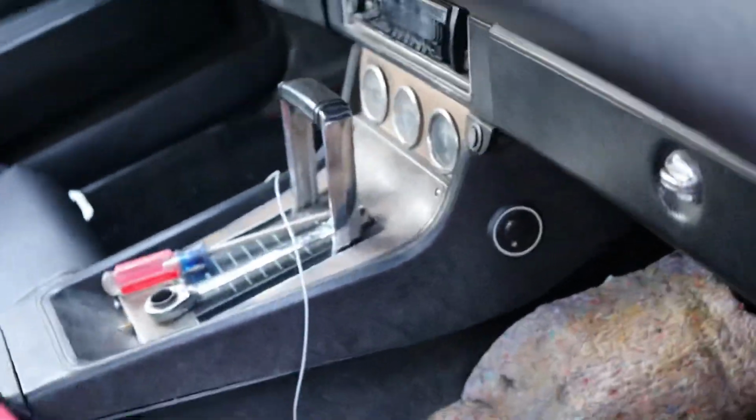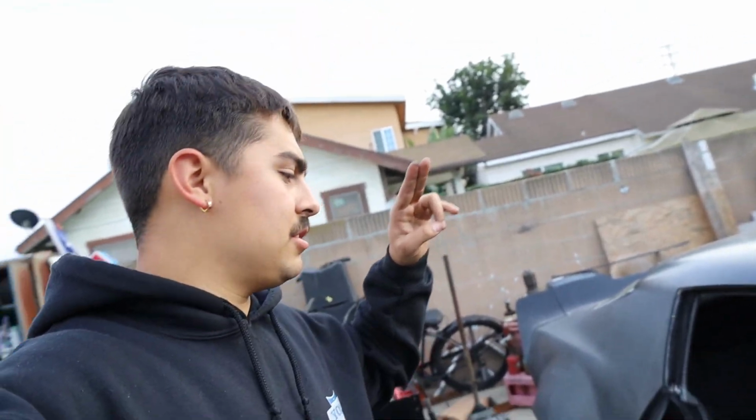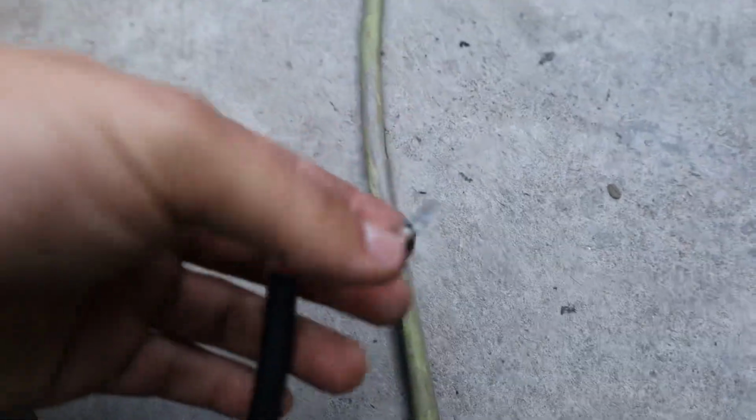So we got this wire, which was giving him power, and it runs to the bottom of his fuse box. You could either have it hooked up to a battery spot or an accessory spot. The only difference is the accessories will only work if your car is on. So if you want the seats to be able to move when the car is still turned off for whatever reason, hook it up to your battery or any open spot that you have. So we're gonna combine both of these two powers to go to an extra battery opening, and then the ground, you just ground into a clean ground spot, and there you go. That's what's nice about these seats, is that this is all it is right here. You got one power and one ground, and everything works with just these two.